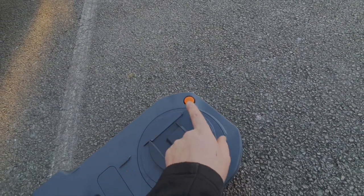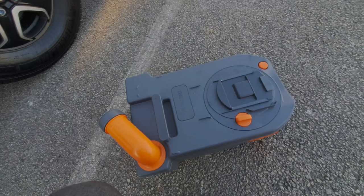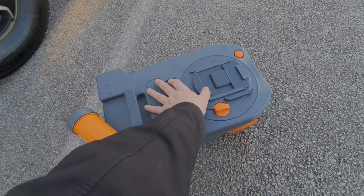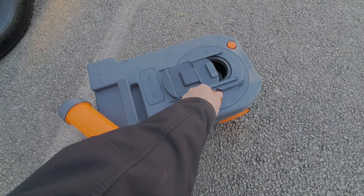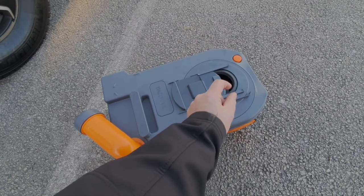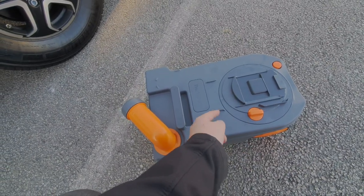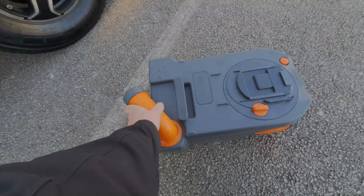As you're doing that, press this button in here — it lets air into this end of the cassette and lets the liquid go out of there; it prevents splashing. This cassette requires a chemical to break down all the toilet waste, get rid of the smells and break down all the solids. To add the chemical, slide this back, open the valve inside there by sliding it back, and once it's empty put the required amount of chemical into here and just line the bottom with a little bit of water — then it's ready to use again. If you want, before you put the chemical in, you can fill the cassette back up with fresh water, give it a swirl around and empty it again, then put your chemical in once you've cleaned the contents out.